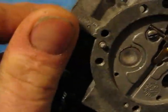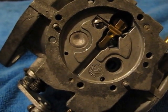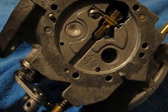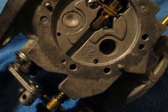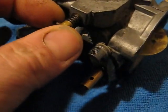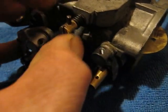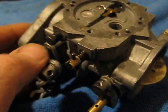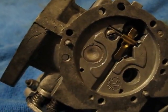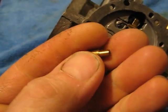There are two things that can happen if that ball is no good. Number one, it'll either flood mercilessly and pour fuel out the front, flooding the bottom end of the engine. What you can do to eliminate that temporarily is wind the high-speed screw all the way in — that seals off that valve. So if it is a problem with your high-speed check valve, it'll stop flooding and you can confirm that's where the issue is.